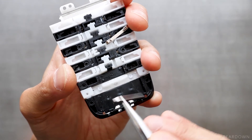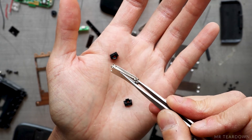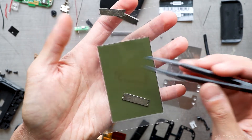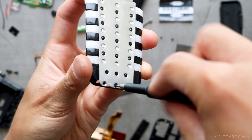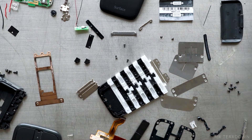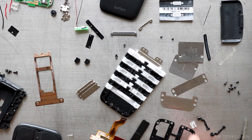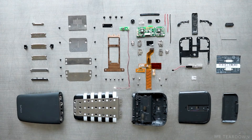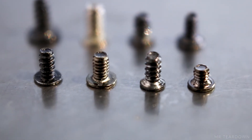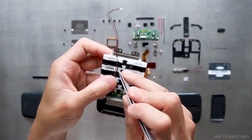The snappiness of the bending mechanism is produced by this group of magnetic parts. There is a steel part on each end of the range that acts as the end stop. The slider that follows the free end of the bronze bracket is formed together by two plastic parts, two steel parts, and one magnet. Finally, three screws can be removed from the very end. There are over 70 components including 23 screws in this mouse, with eight different types of screw, and it took me around 45 minutes to put everything back together.